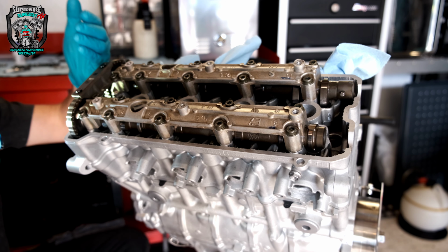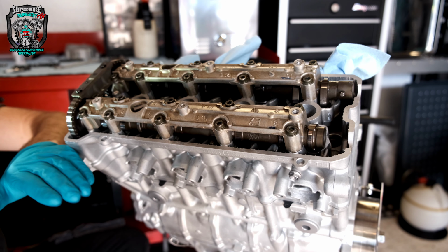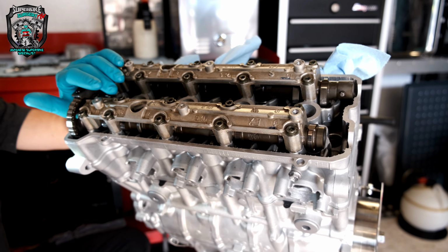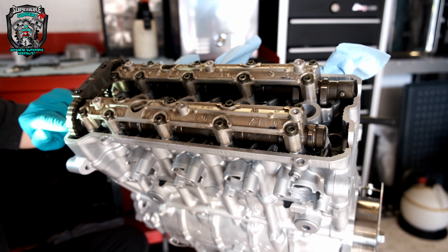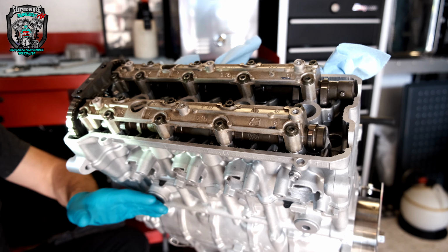You've got the tensioner blade on one side and the straight blade on the other. You always time on the non-tension side, so you pull the chain tight against the crankshaft so there's no slack, and then you line up the mark on that straight run down that isn't the tension side. Is that making sense?